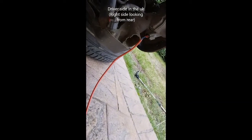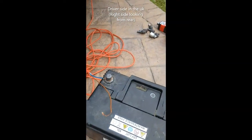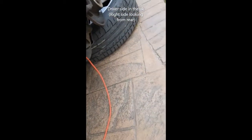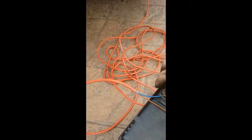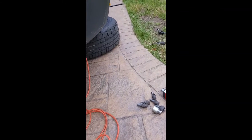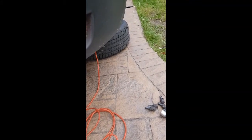Okay, now we're doing the driver's side of the car. You can see over here I've put the terminals the same way around — blue ones to the back. But this time I noticed when I took the wires off that the colouring was the other way around. So I'm making a guess and thinking that if you put blue to negative — that's the back of the car to negative — you'll put the brakes on. Let's find out. Yep, okay. So on the driver's side you have to put the terminal that's the back-most to negative to put the brakes on. Now let's back them all the way off — we take the back terminal of the caliper and put it on positive this time, and feed it till the brakes come all the way off.